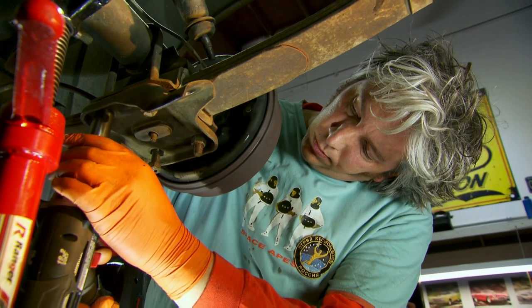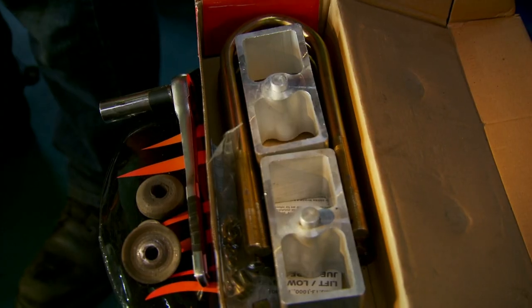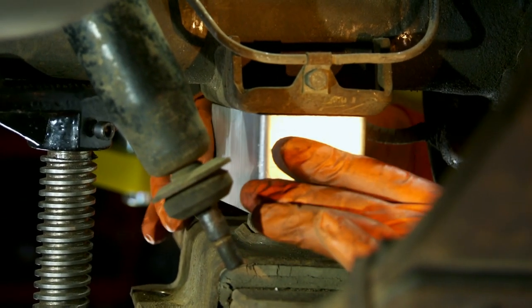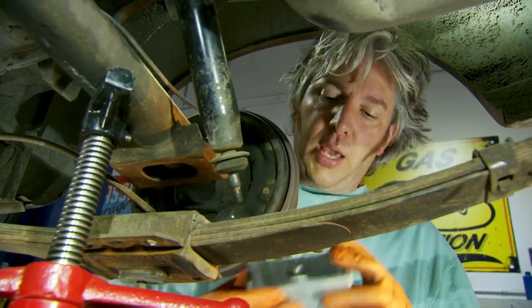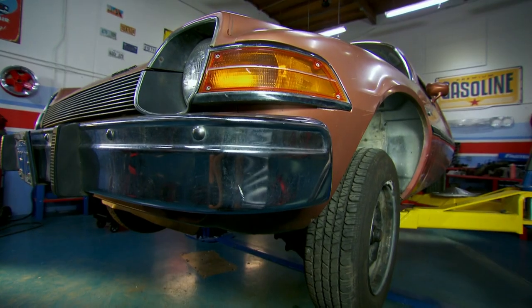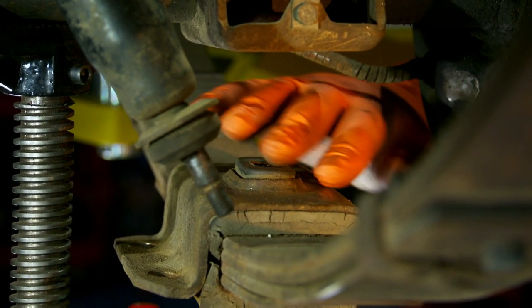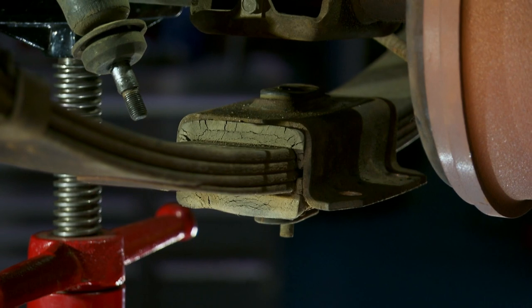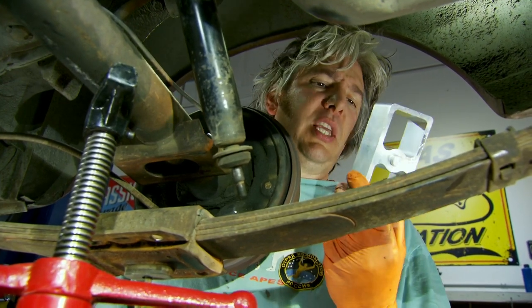The new, longer U-bolts will lock it all into place. We've managed to separate the axle from the spring — thankfully it wasn't too hard. But we have a problem. The axle needs to be located by the top of the block, and there's a big slot in here and a small peg there. The spacer has been fouled underneath by this bottom peg too. A poor fit is dangerous as the axle will be loose in the suspension. Bad news is I can't continue — I need a custom part which might cost a lot. So it's back to Mike to see if he can sort that out.